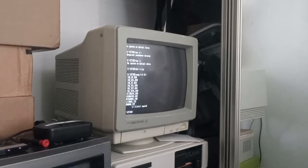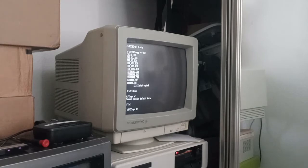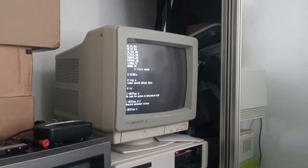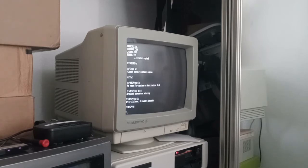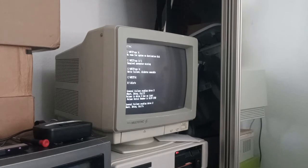Okay, and now we're going to pull in. We're going to move the disk over to B:. We'll just use the secondary floppy because A and C both are on there. No room for system on destination disk. Alright. It says no room. Okay, well, we may have to boot off of a different... It's not reading on that drive, so I guess that drive might be bad. We'll just slip it back in the other drive then. Just fail it. I probably need to clean the heads in that one because the B drive's been sitting in storage for a while.